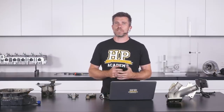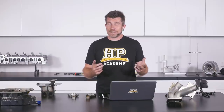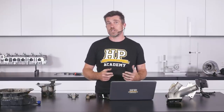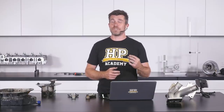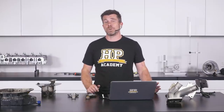This is a question we quite often get asked — how do we actually make adjustments to our bearing clearance? The answer is that unfortunately it depends on the engine you're working with and what sort of adjustment you need to make. In the mainstream we're quite often going to be dealing with engines which use what's referred to as graded bearing shells — this is kind of a factory way of blueprinting the oil clearances. Those graded bearing shells vary very slightly in thickness, and by mixing and matching them we can get our clearance exactly where we want it.